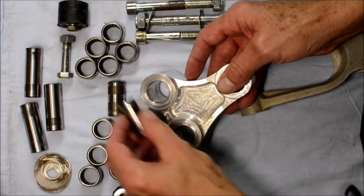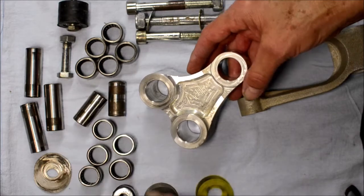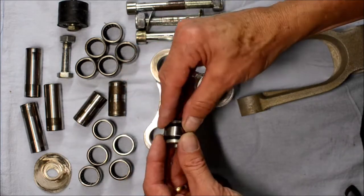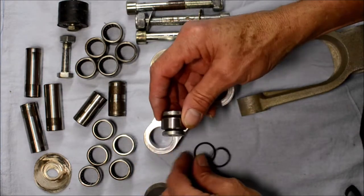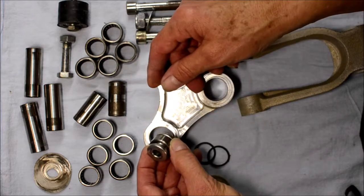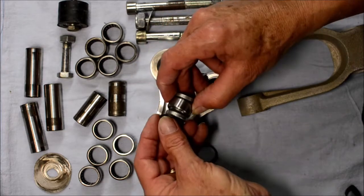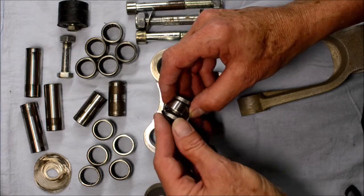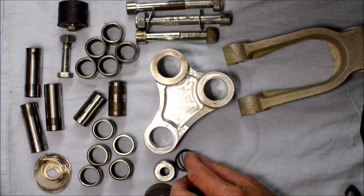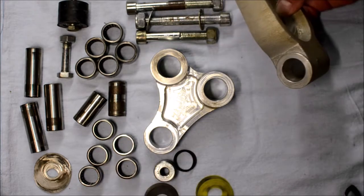The bush hiding under the swinging arm was in a lot better condition and is almost reusable. The best bearing bush is the spherical unit at the bottom of the shock — it's solid, just a sliding ball joint, and it's perfect. That seems to be well designed; they've thrown in these o-rings and they seem to do the job. There's no wear at all on that, so that part's well done. But the needle rollers are a little bit low par for long term.